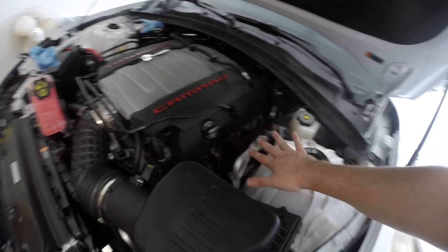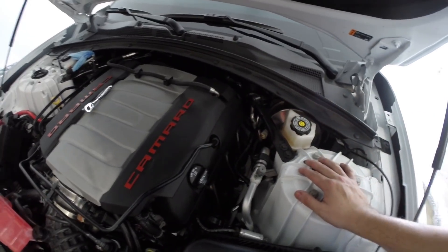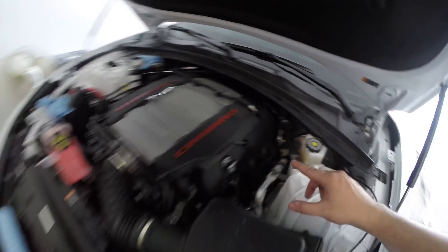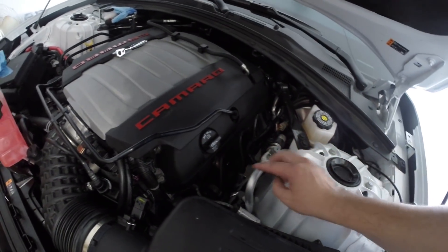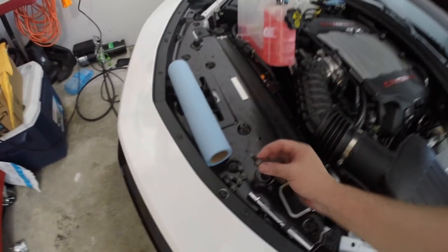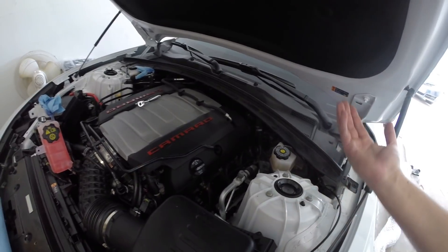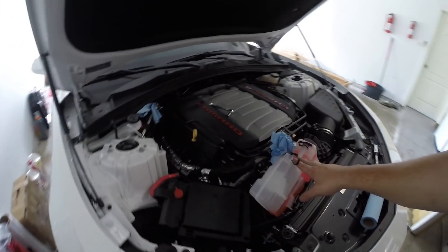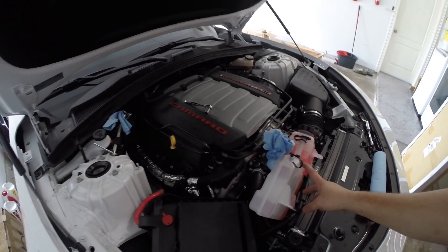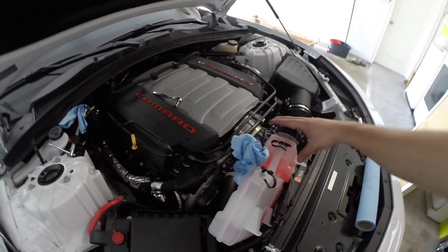Alright guys, I've made quite a bit of progress. On this side there's a heat shield with three 10-millimeter bolts right up on the top that you go ahead and remove. Then I went ahead and removed the spark plugs — I have just the wires dangling, not too worried about those. I've already removed four of the five header bolts, leaving one in so it doesn't just drop. On the passenger side I've moved the coolant tank out of the way — I vice-gripped and clamped the hose on the back, so I removed the back hose and left the front one intact.